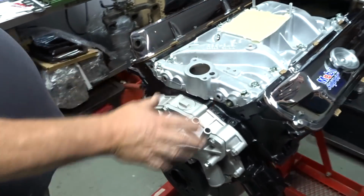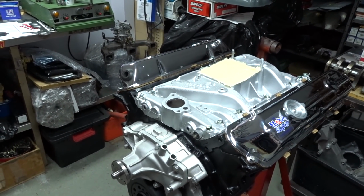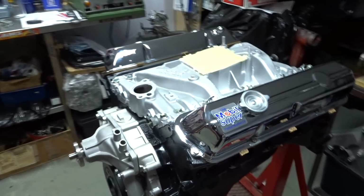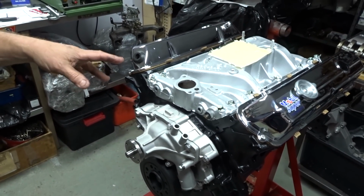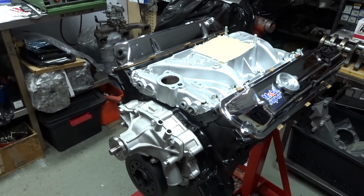That's exact replica internal engines. Now as for this car, the guy bought it from somewhere in Queensland, and the camshaft ate a lobe because the spring tension was too strong on it. And so when we pulled it apart, we found out it didn't have any of the original bits in it. So someone helped themselves to the nice parts.